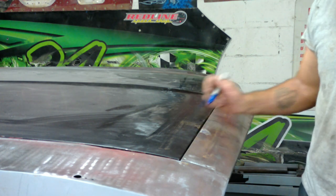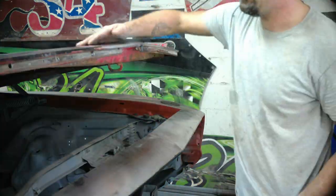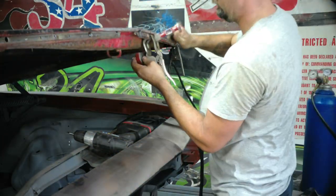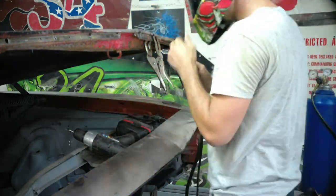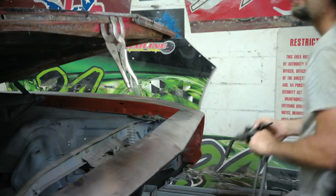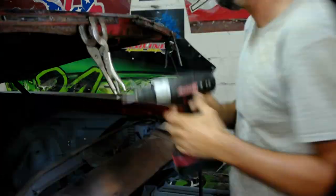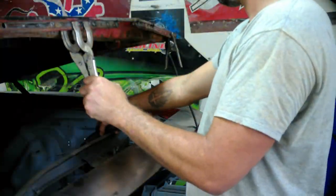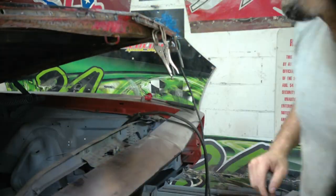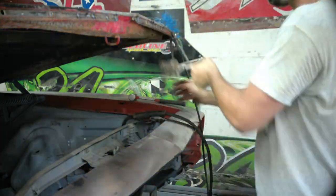The rest profiled really nicely and the corners worked out really well. Things like this make a big difference especially when you're trying to put filler on the edge of a hood — same thing as a door, it's bad practice because you're always slamming it. You want to get these corners right. It's so tedious and so small, but the rest of the hood looked good — only the edge would have been an issue, but that's where you start chipping when corners aren't lined up. This hood only had four or five factory spot welds in the whole front — I put one every inch and a half to two inches, using a 3/16 drill bit. We're also going to need to clean out and sandblast underneath since it's a 50-year-old car that's been sitting outside. Before really putting the work into converting it to a shaker hood I wanted to make sure it was going to fit on this car.